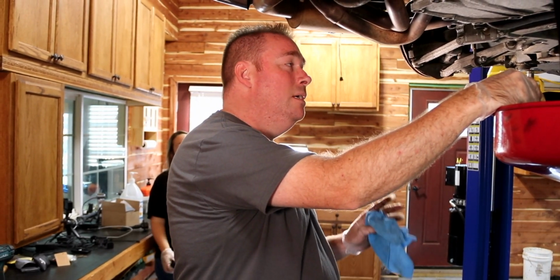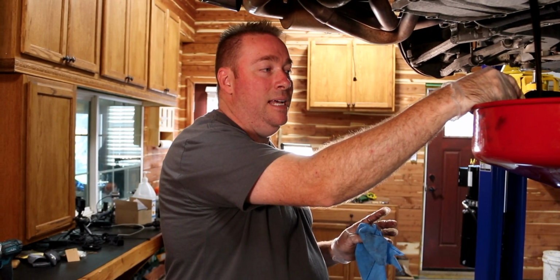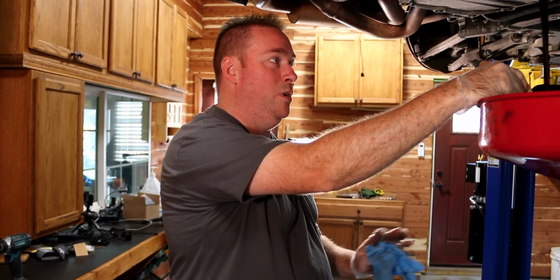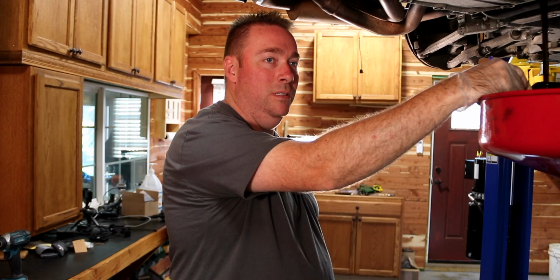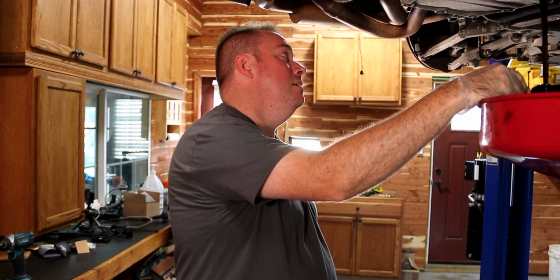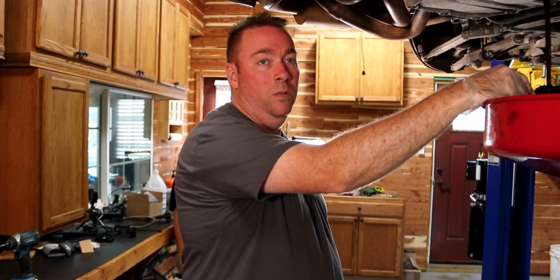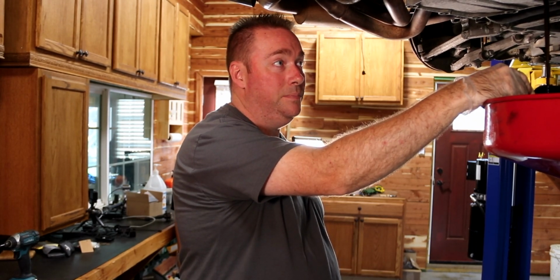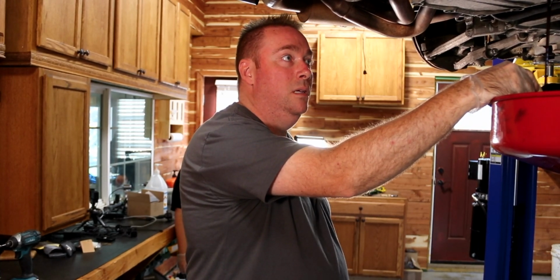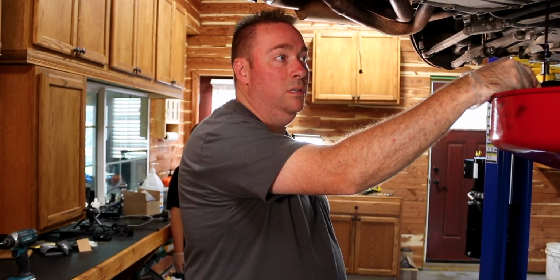At this point in time, we have to take the engine out. We got to do all the stuff to it. I think it has a cracked head, even though it doesn't. It starts and drives perfectly. Doesn't smell like coolant. Doesn't smell like anything. It smells totally normal. Best case scenario, somebody dumped oil in the coolant reservoir by accident. Worst case scenario, it's a cracked head with bore score. But the cracked head's not that big a deal. Actually, we found a local shop to do the bore score machine work.